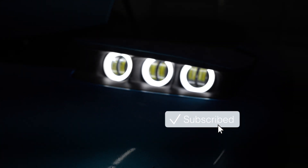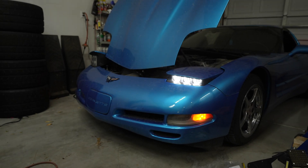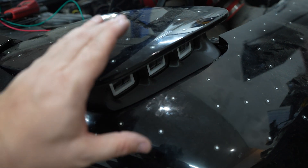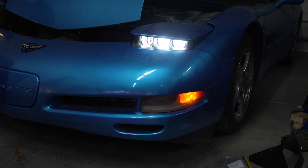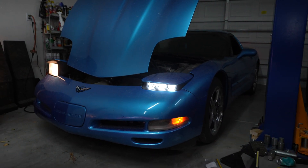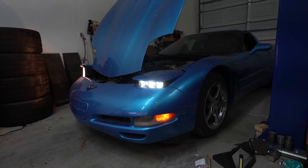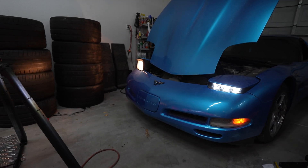I hope you consider how few companies or creators do this — I show the good and the bad. On the round side, we do have some contact with the lights that will need to be relieved, and that will get rid of the gap I'm seeing on the side. The squares need a little more refinement: we need to bring the lower floor higher, refine the top edge, and make a small amount of additional clearance for the lights themselves. It's not a decision — I love that it does not harm the car from a completely stock look, it only helps. It's not overly aggressive, but yet when you have an aggressive car around it, it does look aggressive. The hardest thing to achieve with a modification is to do something that could almost be stock and really work with anybody's style.